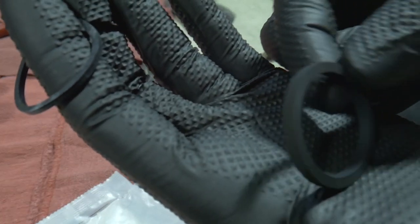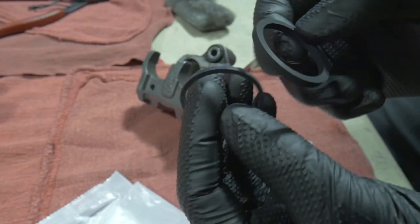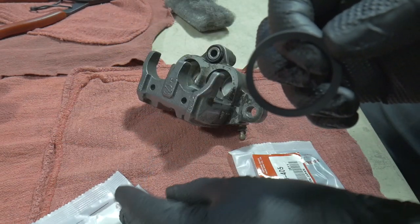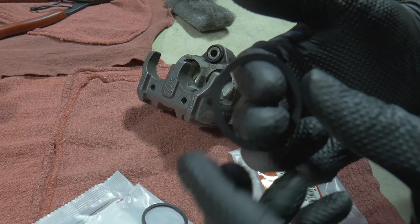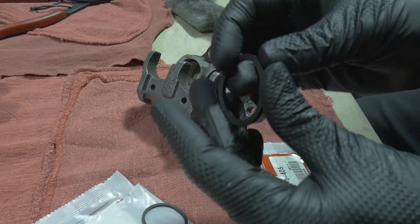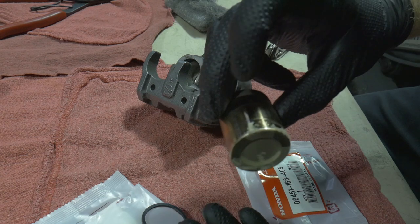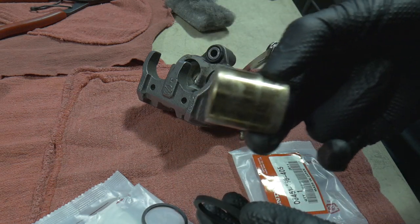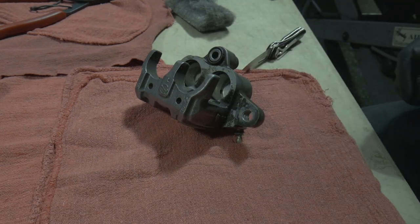You have this one which I'd consider the brake fluid or spring seal, and this would be more of like a dust seal, but it also helps with that spring action. The reason this seal is square is because it's sitting inside of a pocket. The piston sits inside of this seal, and as that piston functions, this seal flexes, allowing the piston to go forward and then return back again — it works almost like a spring or a retention ring. All part numbers and tools will be in the description below.